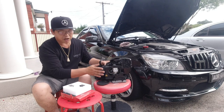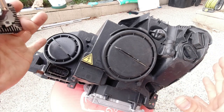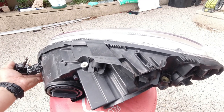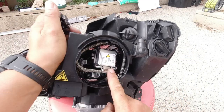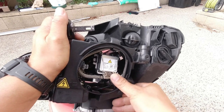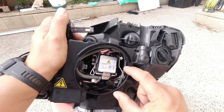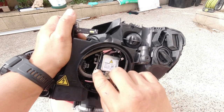So here we have the headlight tilted up. When you install it on the car it's going to sit flat, and you just remove the cover by turning it counter-clockwise and pulling it off. Now tilted back up, you can see there are two pins — one there and one there. You push them down toward the light and then go toward the center, and that unclips. If you don't have these pins, you probably have a push style headlight where the bulb just pushes in and clips in.